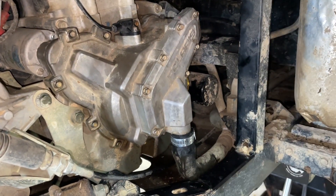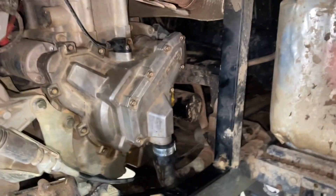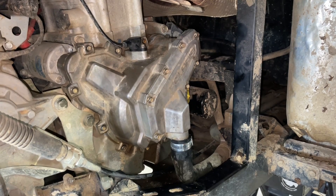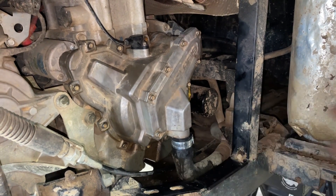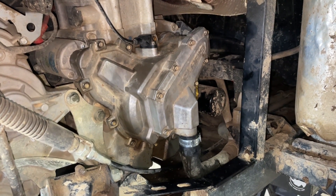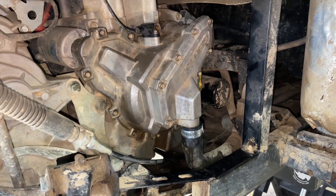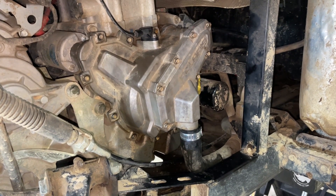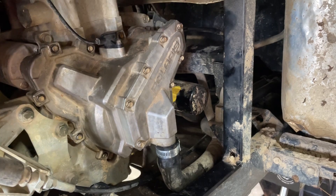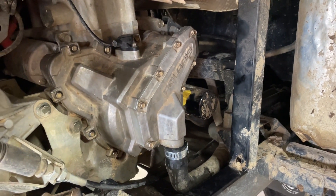We're going to let our machine down, put our tire on, and this right here wraps up this job. If you're looking for parts to complete a job like this, it'll be down in the description along with our other YouTube videos. If you like videos like this to help keep your machines up and on the trail, don't forget to subscribe and check us out on other social media platforms. When you get this thing set back down, don't forget to top your water off, burp the system, and check your oil to make sure everything's where it's supposed to be.